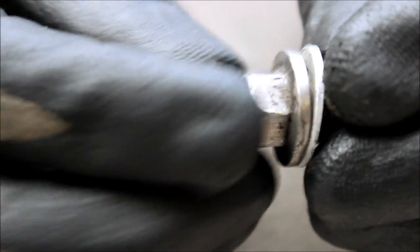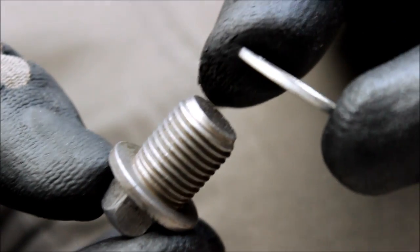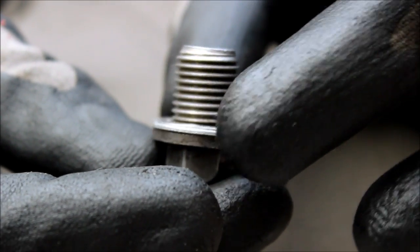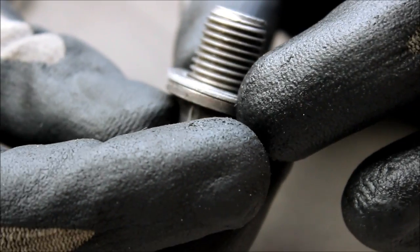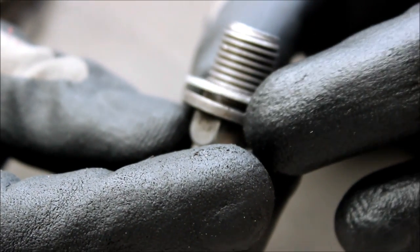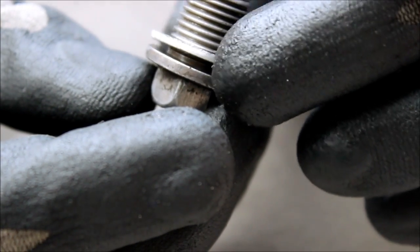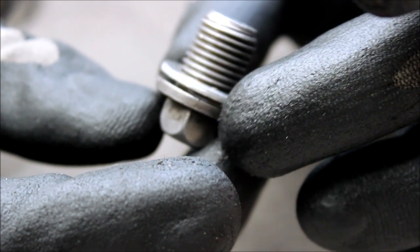Once you take the drain plug out, the drain plug is normally accompanied by a washer. This is a crush washer. You want to make sure that, for one, you actually have it, because when you put this plug back in, you're going to have to have one in order for it not to leak. This basically works as a metal gasket. When you tighten this down, it will actually crush and create a seal. If this looks like it's badly worn, it's common practice to change these out. But if they look like they're in good condition, like this one actually seems to be, I'm going to reuse this. But if it looks pretty bad and scored, get a new one. You can pick one up at AutoZone, O'Reilly, stuff like that — they're pretty cheap.